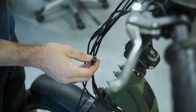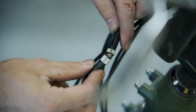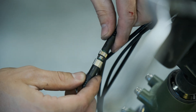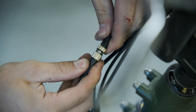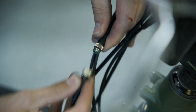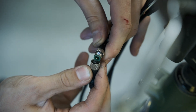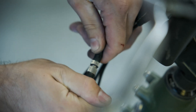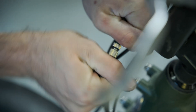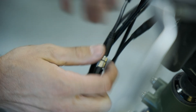This little screw-type connector — you want to be really careful with that. This is what Rad Power decided to use. You just want to line them up and slowly wiggle it in. Line up these two slots, press it in tightly, and then screw the connection. That's it.